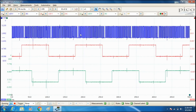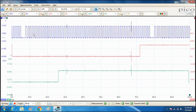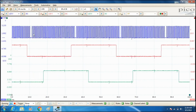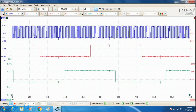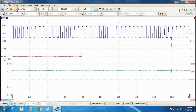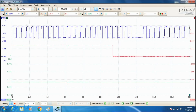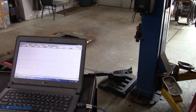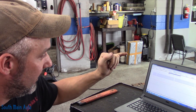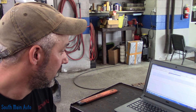Actually, we're right here — let's hop in and run it up to around 2,000 RPM and see if something crazy happens. We're going to elevate the RPM, see if it does anything to our crank signal. Well, we definitely didn't lose it. We also checked against our known good waveform and timing appears to be on, give or take a degree or two, so that's not a concern.